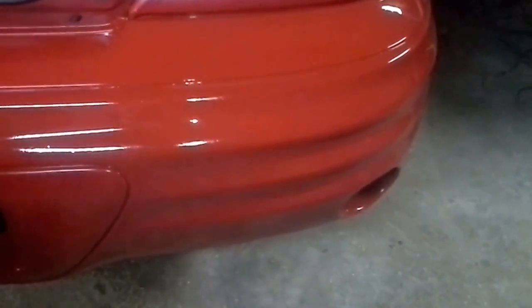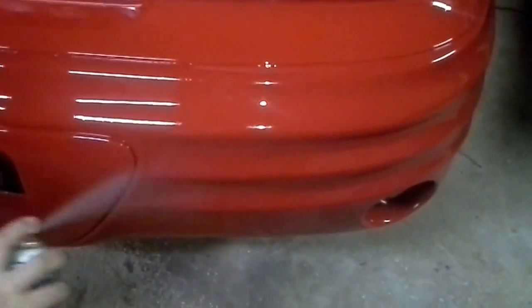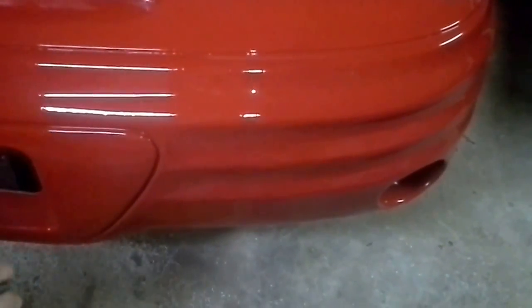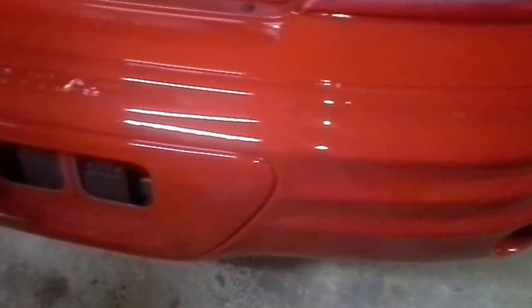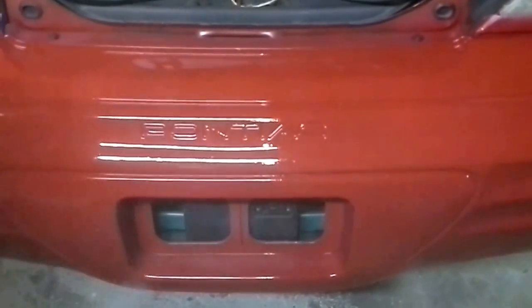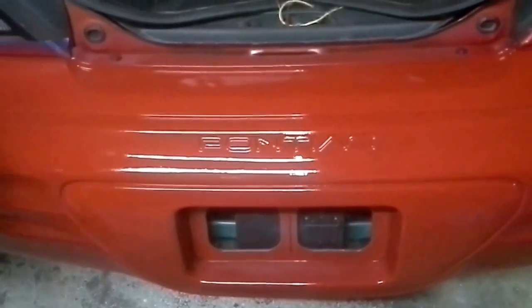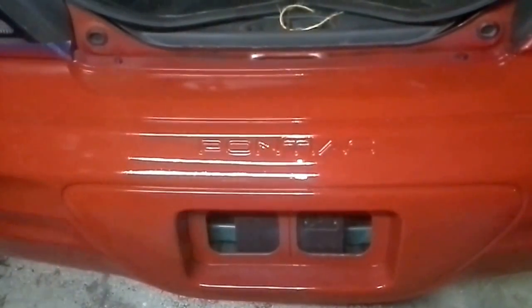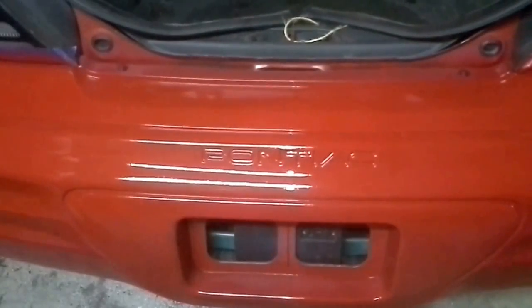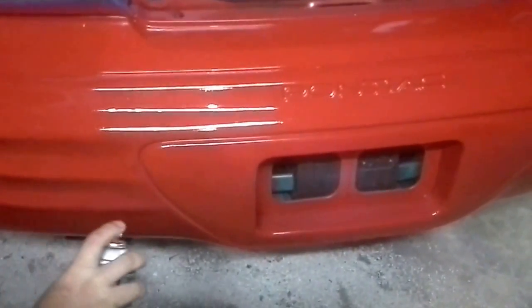And how long would you say they need to let it cure in between? How long has this one been curing? Oh, I usually give them a couple hours at least. Half the time I just come back the next day, just because I don't like to deal with wet paint. Right. So this one's been probably every bit of 6 or 8 hours, and it's been pretty warm here today. And that's something else you'll really have to pay attention to, depending on where you're doing your painting, your climate and stuff, because you have to add a lot of extra time for drying if it's not really nice and warm when you're doing it.